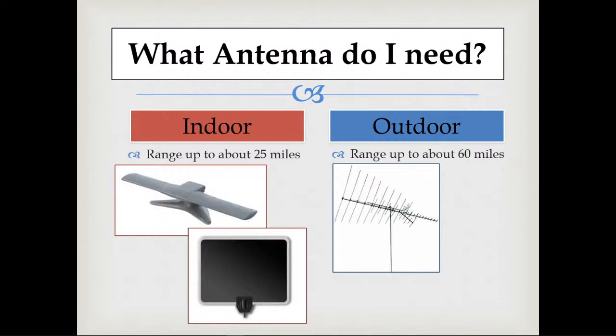They took the satellite dish, returned the box, and basically all I did for the first step was I got an antenna. I knew I needed a big one, okay? So I went and there was a pole that was left there. I took something like one like this, put it in the big pole that was in the ground, and screwed in the coax cable, or the cable, whichever you want to call it, and went inside and then told the TV to scan for channels, and it picked up some. It was like, yeah, all right. So that was really my big thing. Making sure I had it pointed in the right direction was also a big one as well.